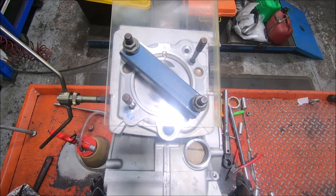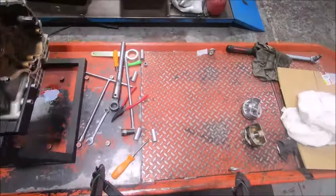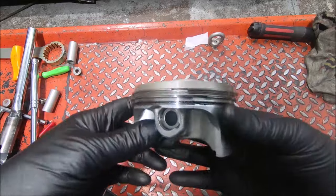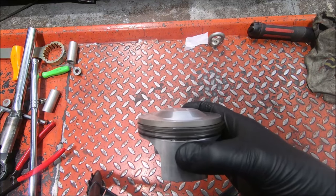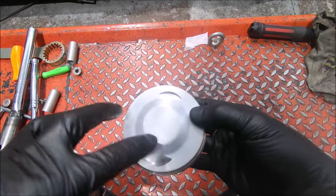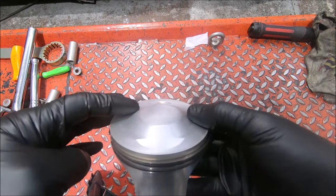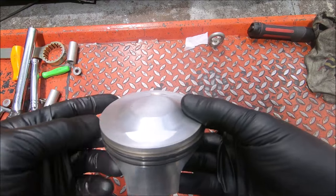Now I know it's about 11.45 to 1 by the numbers. That means it's a little bit too high — I would have been really happy with high 10s, but 11.5 I'm a little bit concerned about. The way to reduce compression is to machine the piston crown. That crown is about 42mm at its outside edges, so taking a millimetre off takes off a couple of cc's. If I take 2mm off, I should get back to 10.8 to 1, which will be nice.